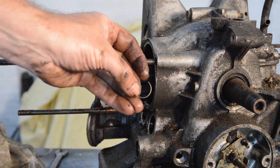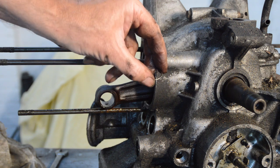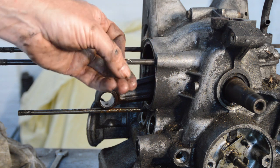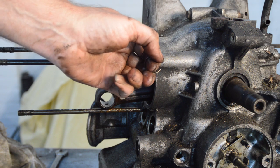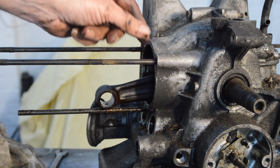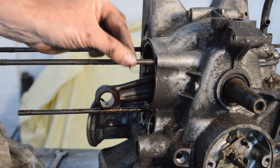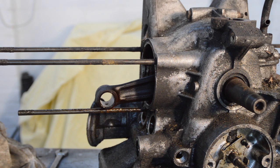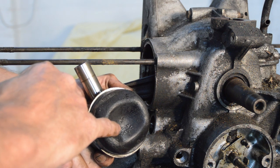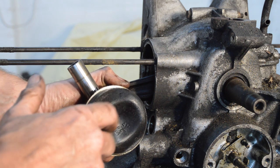The circlip is just a bent piece of wire — it cannot be reused, you've got to fit new ones every time. You can get types with ears, just like internal circlips, specifically for pistons. I can't remember if I've got any of those for this but I'd rather fit them. The pistons are marked up — I'll clean them off and show you better — marked 'forward' with an AV and an arrow for forward. I want 8.5 compression on these.